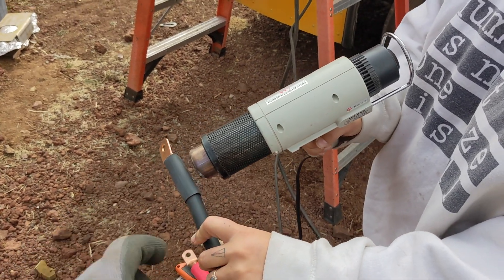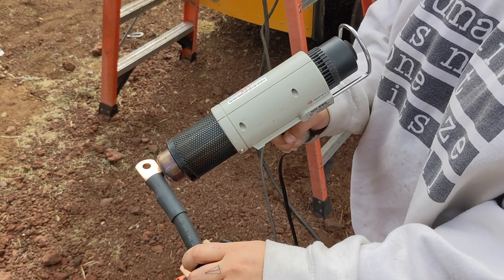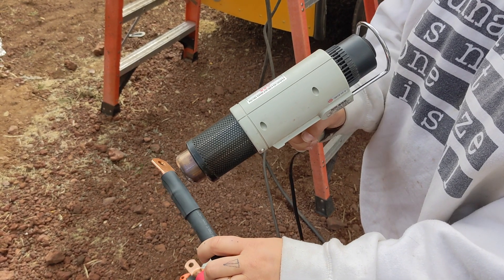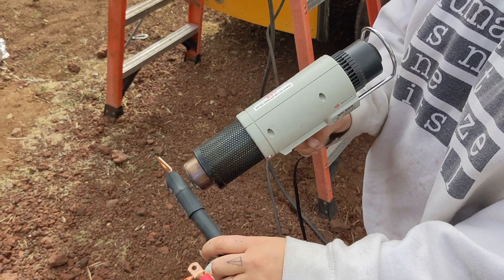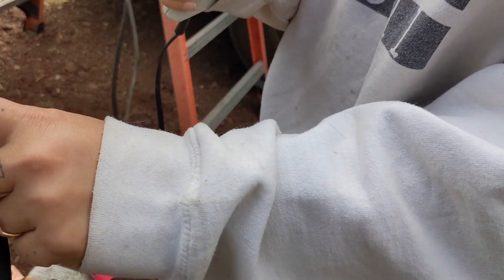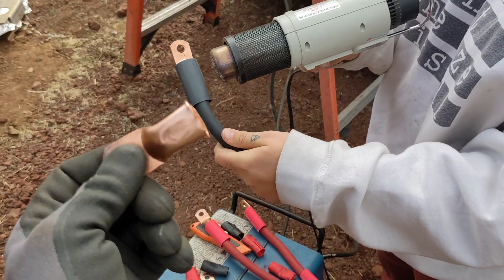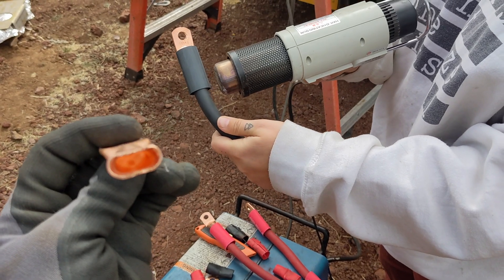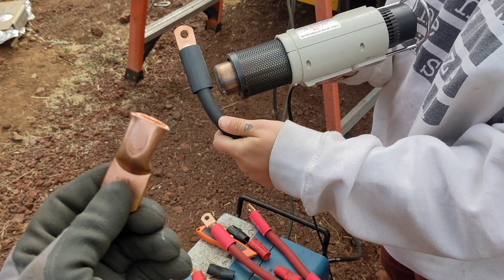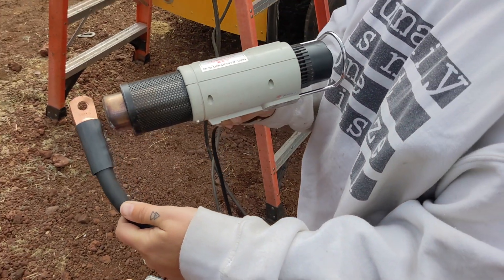Those are really well crimped on there — they are mechanically fused with the copper. They won't come off. It just shows how much vibration there is in a bus. These were done with a hammer — you got to do what you got to do with the tools you've got — and that worked for about three months, but during the shifting of the batteries one of those came loose.